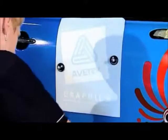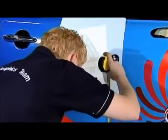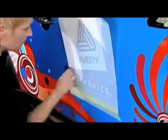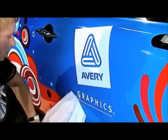Now that the car is fully wrapped, the logo can be placed. Measure out the exact position of the logo and give the surface an extra cleaning. In this case, the logo is made of a cutout Avery cast film, which after cutting has been provided with application tape. Use the basic techniques to apply the logo to the Mini and remove the application tape.